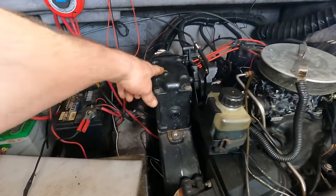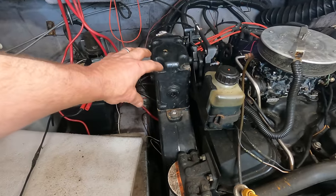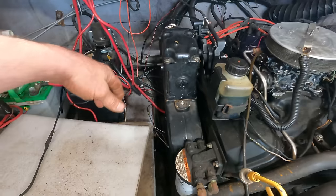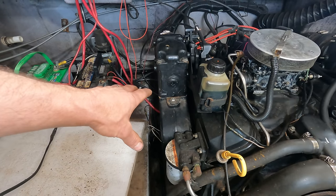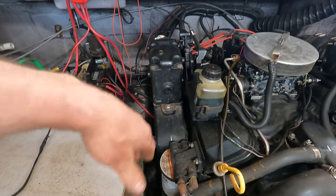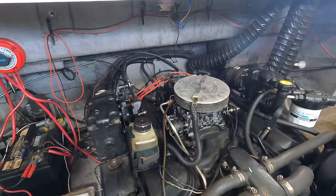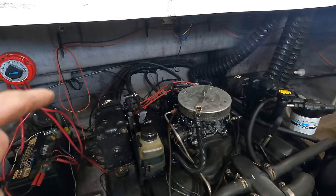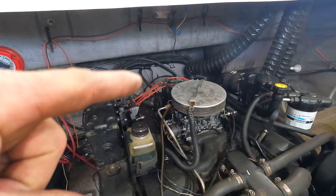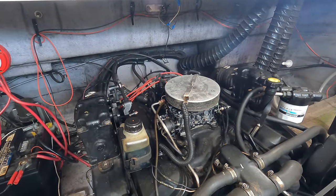So these things here are exhaust manifolds that have basically a water jacket surrounding the exhaust. And there's a gasket here, there's various seals on that system. And if those leak, water then would run to the exhaust valves and be able to get into the cylinders. So that would be the other case. Although, there was water on both sides. So either both exhaust manifolds failed simultaneously, or it came in through the carburetor. One thing I'm going to do, I would like to look at the cylinders again, at least a few of them.